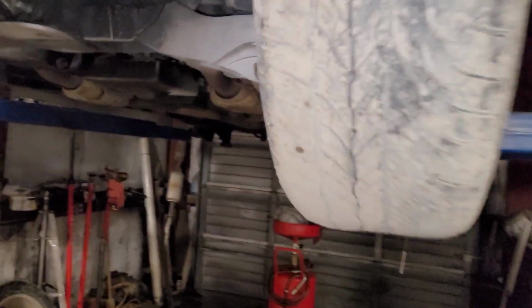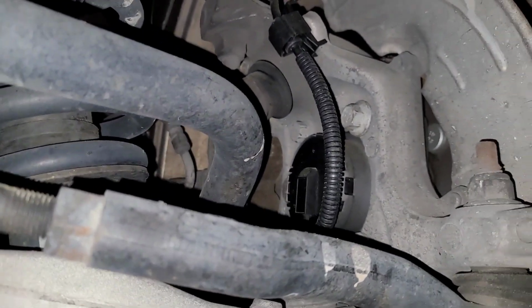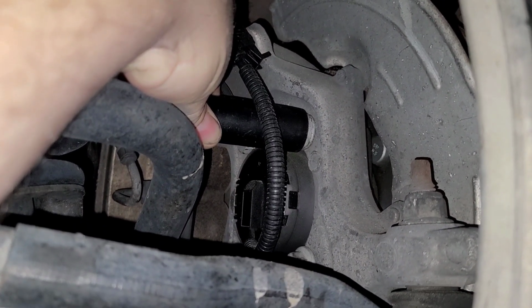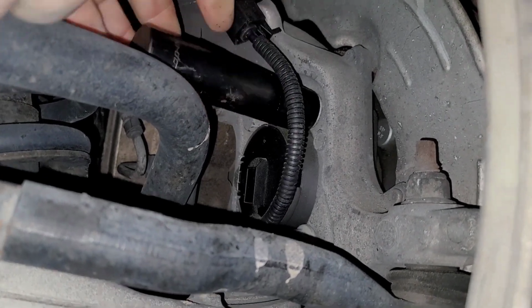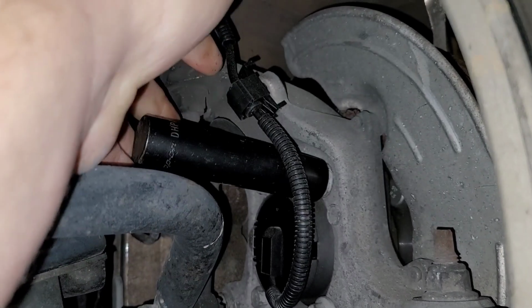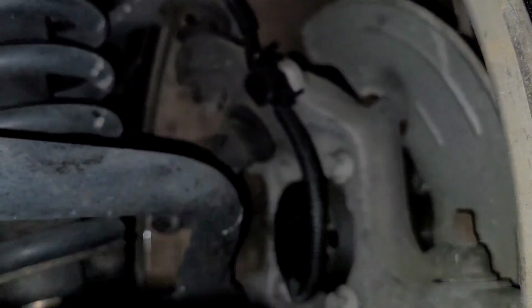What they're for is when you're changing a front hub bearing, especially up north, on a 4x4 truck, you take the 4 retaining bolts out and you're trying to get the hub out, you're sitting there with a sledgehammer beating them to death. This tool, let me see if I can explain it, it's on the lift. On the Dodges, what you would do is you'd loosen the bolt up, you'd have it sticking out, and then this tool would actually butt up against the front differential. You'd have to have somebody sitting inside, or you could do it yourself, it's just easier if you have somebody sitting inside. You start it up, and then you cut the wheels. This thing will bottom out, and it'll actually act like a press and press the bolt out that way.